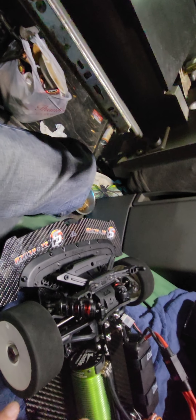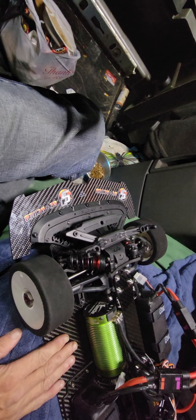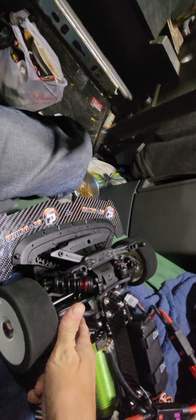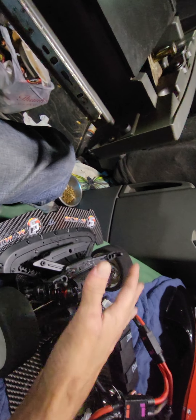This is the DRG Custom RC chassis — there's not a whole lot of them out there. There are only four of these that I know of right now at GT width, possibly five. This chassis is going to act a little bit different because it's weighted a little differently. It's not an alloy front piece — that's stainless steel, which means the front end is going to be heavier than the Scorched chassis. Is that a good thing or a bad thing? I think it's going to be a good thing to help keep the front end down, so I may not have to droop the front end as much — or I may have to droop it more. We're going to inch up on it one change at a time.